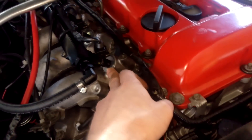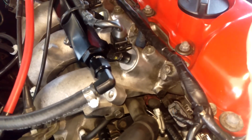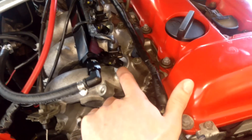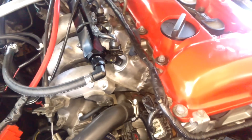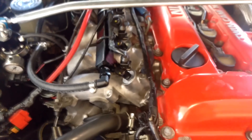On the lower seals I had to change from the o-ring to a kind of square ring, similar to standard R33 or R32 insulators. They were actually provided in a little bag in the kit — the o-rings supplied were too small and didn't fit snugly. You can get thicker o-rings as well, but I used these because they were there and they don't leak at all. Nice snug fit — the injector can't move.